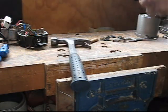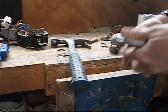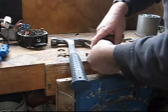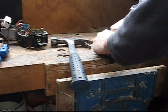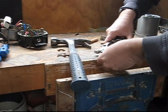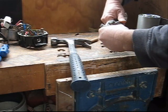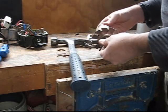The other thing you can use to remove the bearing if you have one is a wheel puller. I've got one here — just a cheap one. Initially I couldn't use it on this because there wasn't a big enough gap, but if you've got a small one or can get the gap started just enough to get the wheel puller onto it, then just wind it off. And then that will pull it off — so there are the options for removing the bearing from the armature.